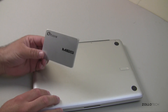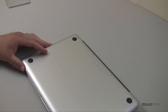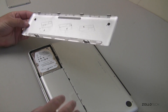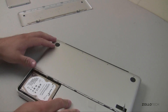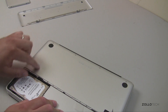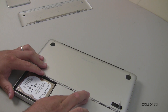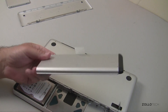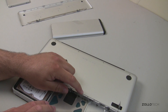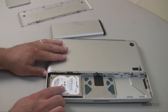The first thing you need to do is get your MacBook ready. On this older style, we just pop this open and the bottom plate comes right off. If you don't have this style, you'll need a Phillips head screwdriver to undo all the screws and pop the whole bottom off. The next step is to remove the battery — on this style MacBook it comes right out, but other models may have a screw and plug as well.